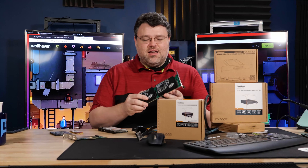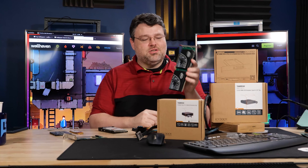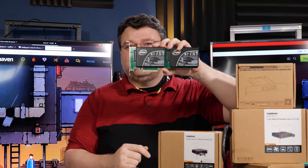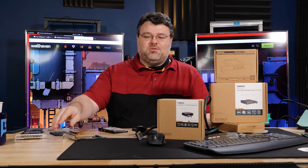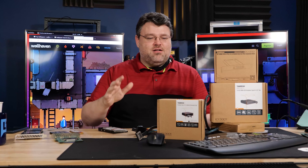Maybe you've got a P5800X Optane, and because you don't have a good PCI Express 4 connection, you're going to run those U.2 drives on an expansion card like this, which converts it to a PCI Express x8 slot. There are options, or maybe it's just a single to PCI Express 4. You plug in your U.2 drive there and you're good to go.